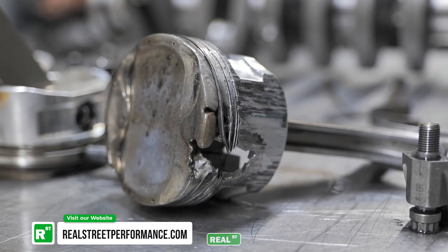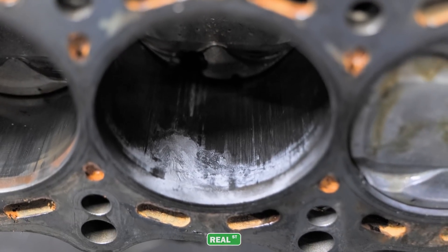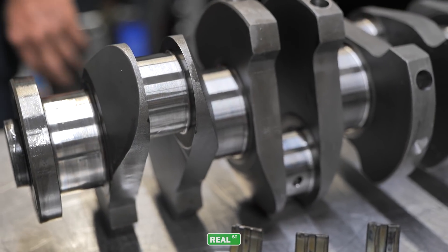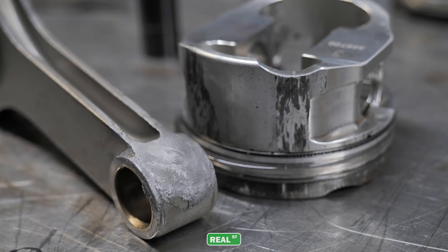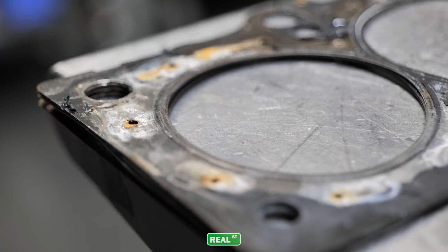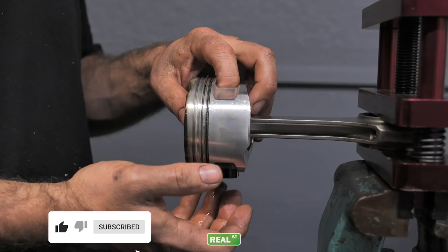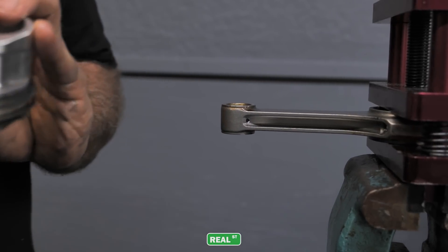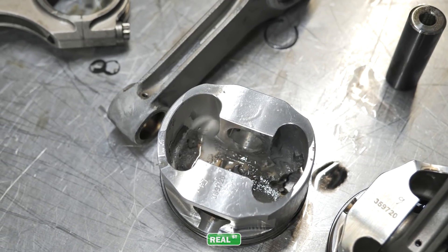As you can see, the pistons just destroyed that — black overheated aluminum. Once the piston overheats it displaces the oil and just starts to scrub the cylinder down, and it's really really gross. The crankshaft looks good, nothing funny going on there. I'll reuse these connecting rods; I just need to get some acid and wash that piston off one rod. As far as the head gasket goes, I'm going to upgrade to a fire ring on this engine now — it's just a lot of time under wide open throttle. Piston pins that slide out gently like that are a good indication that that cylinder has not been in trouble, because the pin bore and pin lock relationship has not been changed by vibration or from the pin shaking back and forth.